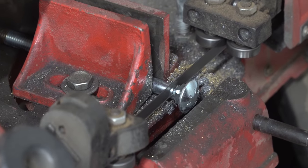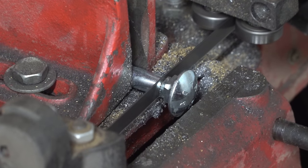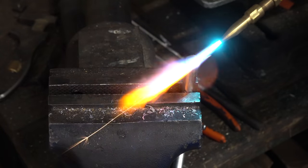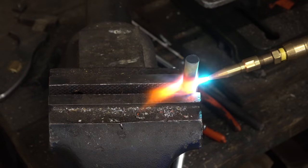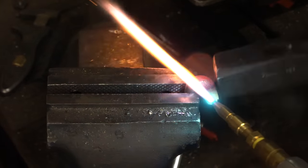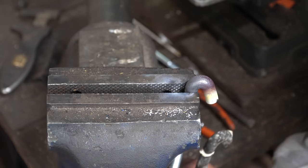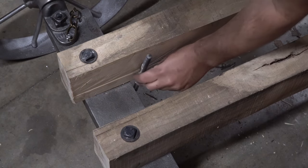I need to also form what I'm going to call the hook or latch bolts that are used for mounting the engine in the back to the actual metal frame we just attached to those wooden pieces. The original ones are completely bent — the threads are destroyed — so they need to be completely remade. It's incredibly simple to turn something straight into a hook. I'll do that twice and try to match up that angle of hook to the original, and as long as it can hook onto that metal frame, it'll add some rigidity.